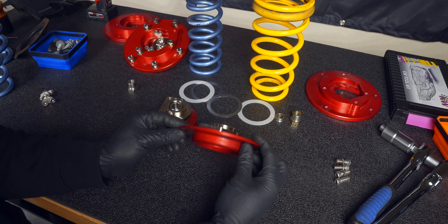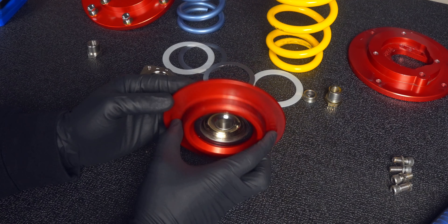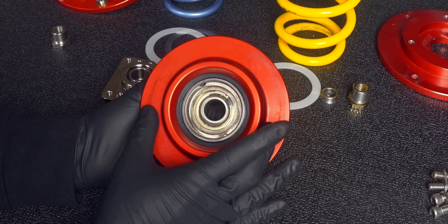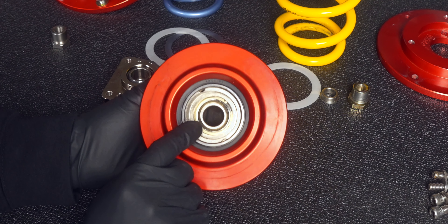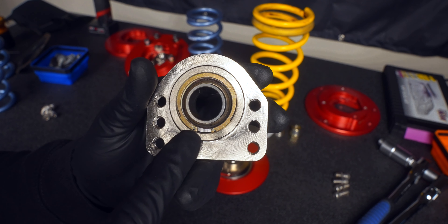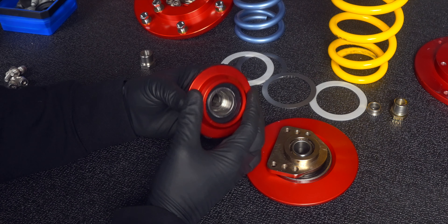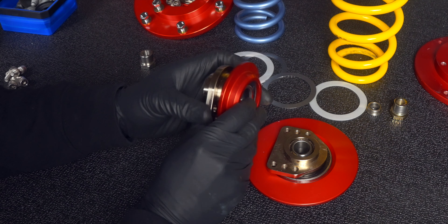The OEM model is very well designed — the perch is pressed into the thrust bearing, so the mono ball takes no direct force from the spring. Even the thrust bearing was still very smooth after two years of driving. The main reason I prefer Vorschlag camber plates is that they use the largest mono ball in any camber plate design, allowing it to take on bigger loads like stiffer springs and piston forces for a longer period of time. It appears to be held in by a snap ring, so servicing should be simple. The only downside is that the smaller perch applies spring force into the mono ball, but the perch has lots of articulation which allows the spring to compress evenly even with increased camber.